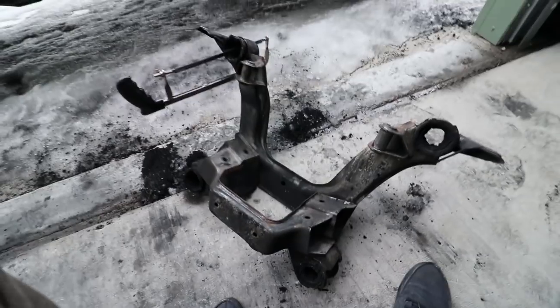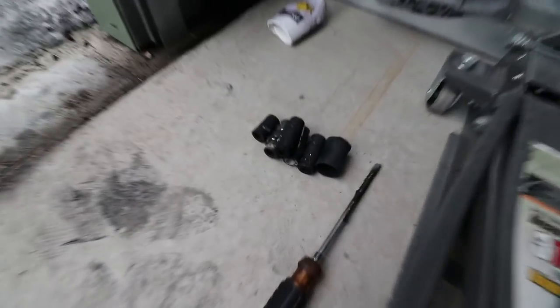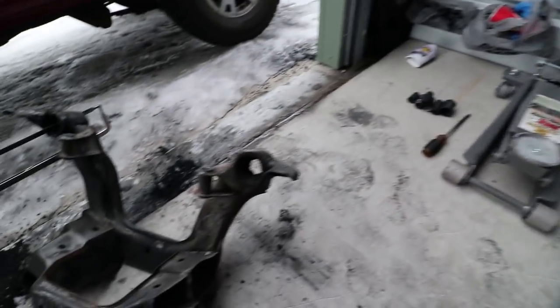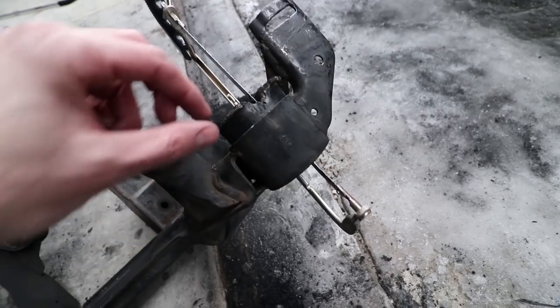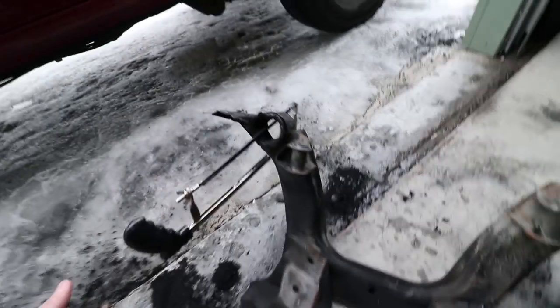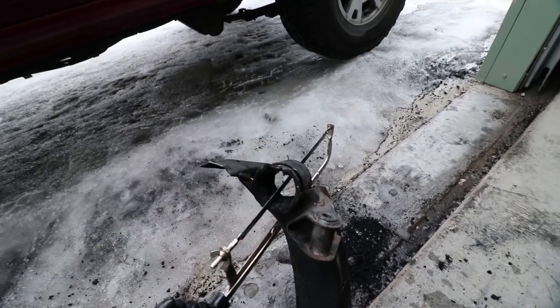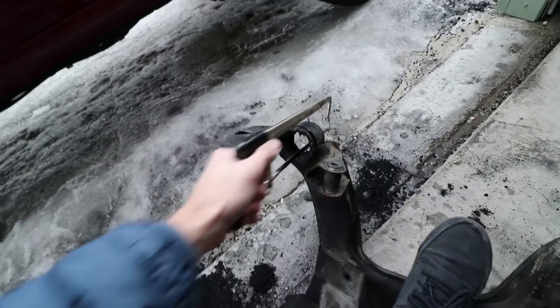Click up here to check that out, or the link is in the description. Basically what worked out the best is just keeping the flames central towards the bushings, so that the metal pieces on the inside burn out. Once those things burn out, the flame can burn a lot faster and get the bushings out. There's also metal that goes along the outside. The way we're going to get the rest of these out is by using a hacksaw, sawing out the ring a little bit, and then once it goes through we can hammer it out and bend it so it will come out of the subframe.